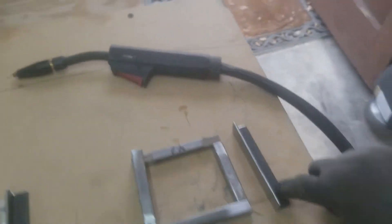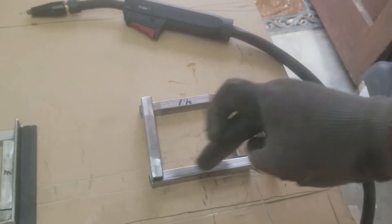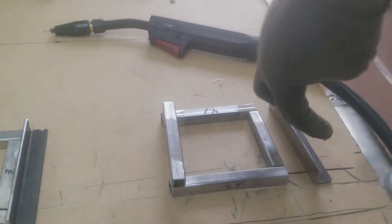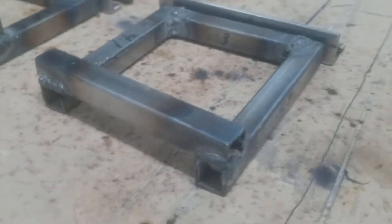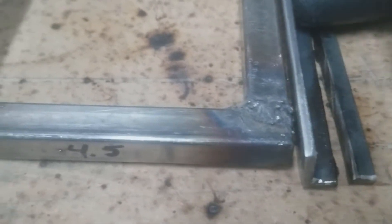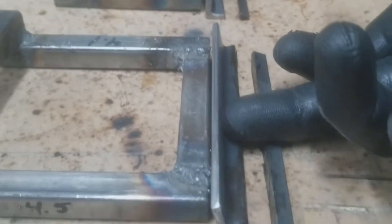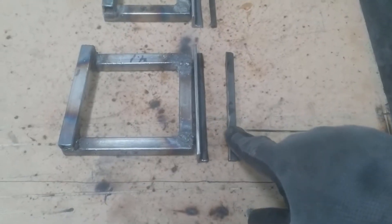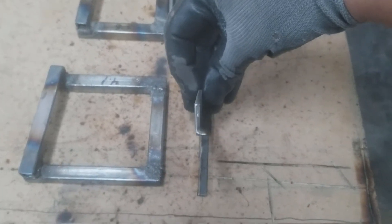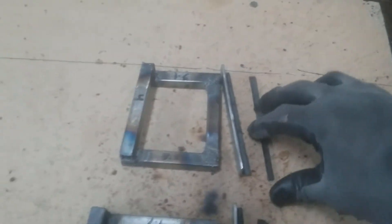This L-bracket piece is on the car welded. This right here will be its own separate bracket and the two nuts will hold it on. I've welded the brackets together — so we have the back piece — this is how they'll sit on the car, of course more spread out. The welds aren't ground down yet so on the back side I'll have to grind them down so this piece will butt up nice and flush. This chunk I cut off the L-bracket piece gives me the right angle for the car.